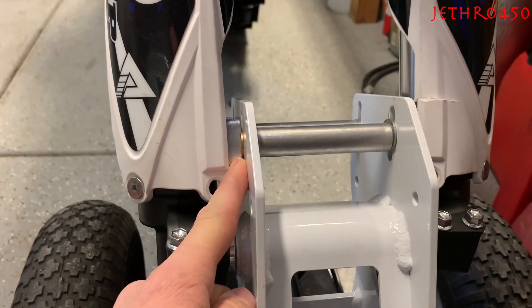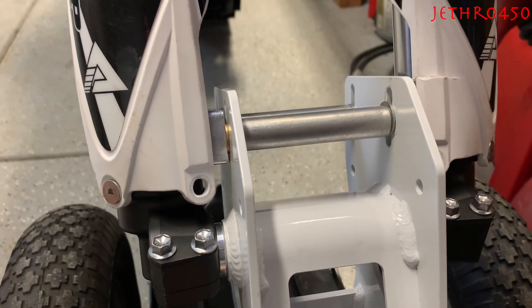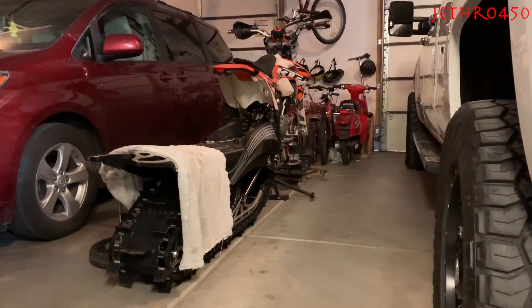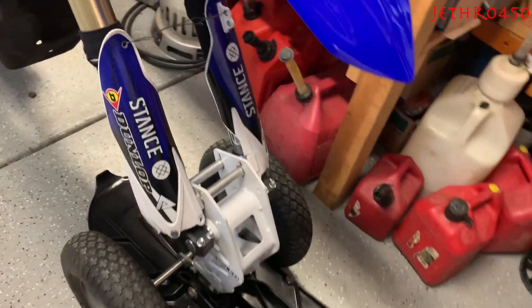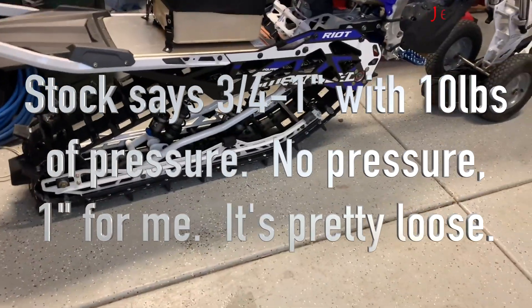I don't know what good it's going to do me to move the brace since I'm already compromised on clamping force — this is how my Arrow was too. I feel like Timber Sled doesn't have quite the right dimensions on their fit kit clamps for this spindle on the Yamaha. This is Yamaha-specific; you'll have to look at other brands to see how they fit up. I've put together a few other bikes for people and none of them seem to have the same problem. A little bit frustrating — I don't know what else to do other than not hit rocks and logs.